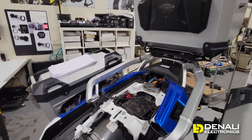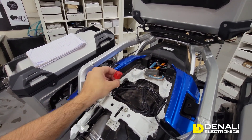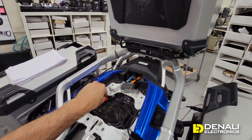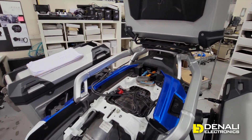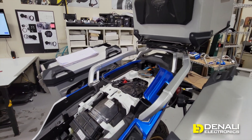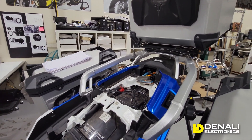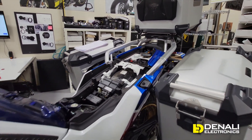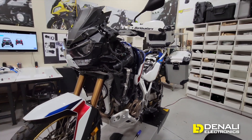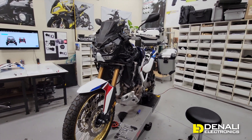We will be providing a link in the description calling out all the specific wire colors on these connectors so you know exactly what to hook up to. One of the last things I'll show you that's pretty important on this bike is the red diagnostic port — that's something being standardized in motorcycles. That's where we would hook up a CAN-smart type system or service dongles to flash codes or enable accessories on the dash. Definitely stay tuned for the future videos in this series where we show you exactly what we've developed and how to get it all hooked up and installed on your Africa Twin 1100.